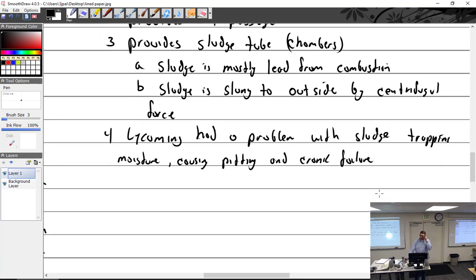I don't know why Continental didn't have the same problem — it's not like they're different in that respect. That issue is all covered by Service Bulletin 530. To clarify: a service letter just tells you general information, like a new engine or oil availability. A service instruction tells you how to do something — how to put the case together, select oil, choose bearings. A service bulletin is almost like an airworthiness directive — when there's a problem, that's when you get a service bulletin.